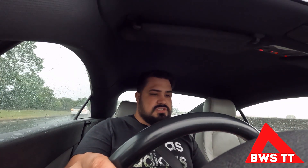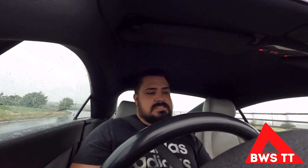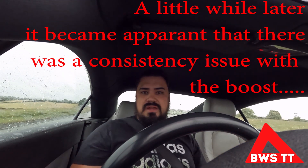I did work on this for Steve back last year. Had a look over it and I know it's a really good base of a car — it's just got a few little niggles to sort. I'm dead chuffed to have another Noggy. We've got a boost gauge so we can see what's going on. First impressions: there's a little bit of hesitation at lower revs off boost — I think we've got some vacuum issues. It had a manual boost controller on and we put it back to an N75. I need to do some logging and see what's going on — all of that is going to be tomorrow.